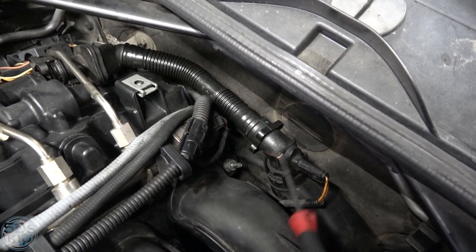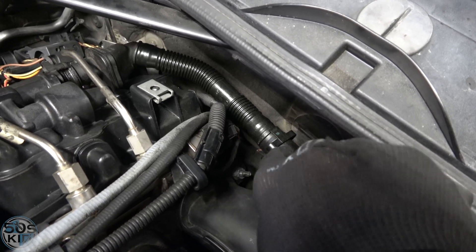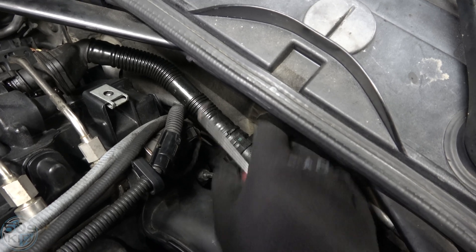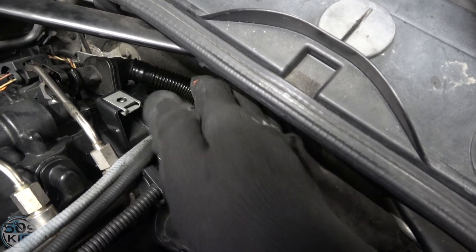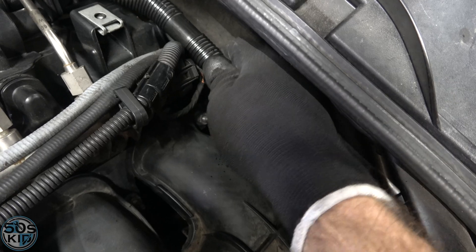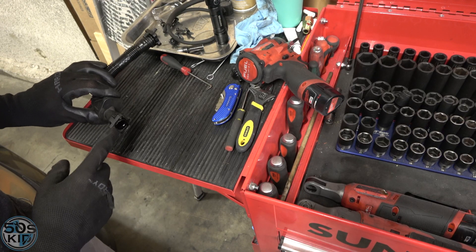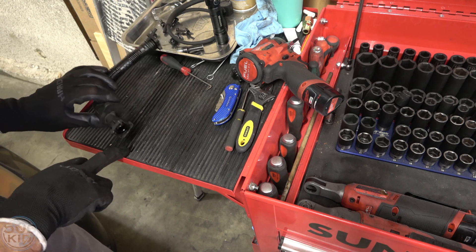The catches are up here and a similar one down below. Since it's an old hose I don't mind breaking it — that just makes it easier to get off. You can see lots of oil wetness on it. There's evidence that this is the primary source of oil getting into the system — a little oil leaked out right onto the rubber pad while this thing was sitting here. The new hose goes on — boom, there we go.